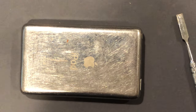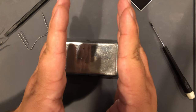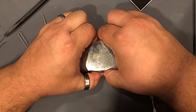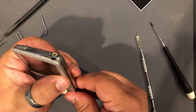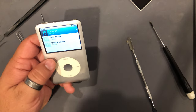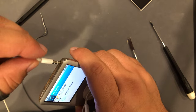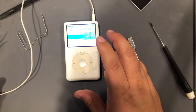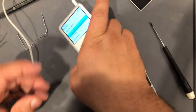That's it. Any time that you open an iPod case, you're bending the outside of it out, and we want to try to close that back in so it doesn't look like the iPod has been opened. What I like to do is just take the case and use my fingers and try to bend it in, then just press down. There we go. Just to be thorough, I like to check to make sure everything is working — center button works, left and right headphones working, pause/play works, next works, previous works, menu works, and the hold switch works. All right, that'll about do it.